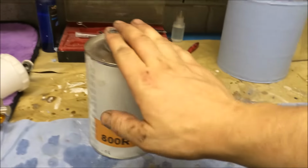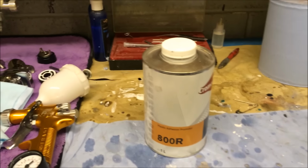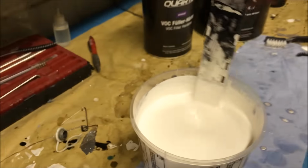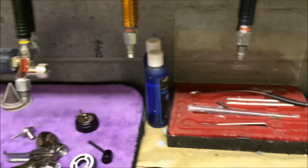Plastic adhesion primer there. It's 1K, you pour it in, and you go and spray it in the booth. It's that simple. Okay, my phone ran out of memory, so I had to go and sort that out. I've already been in with my little SRI ProLite and laid the DuPont adhesion promoter. So we are on to primer.